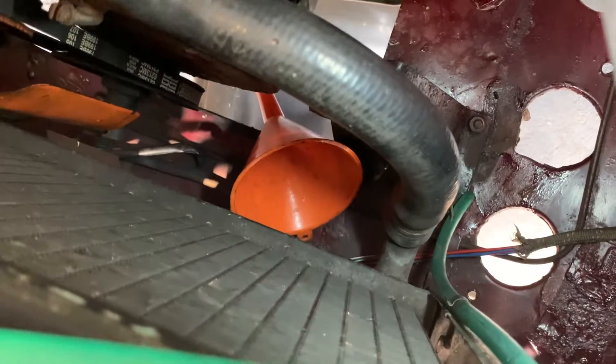The manual says to drain it from the little tap down here. There is a tiny bolt on the underside of the radiator which I think is the drain plug, but I think it's a bit rounded off. I've read that it's not really the best way to do it because you might strip that plug out. I think we're going to have to take these pipes off and drain it that way.